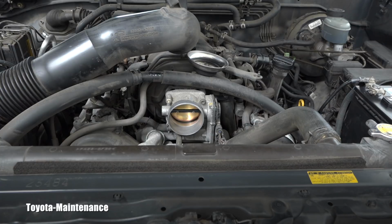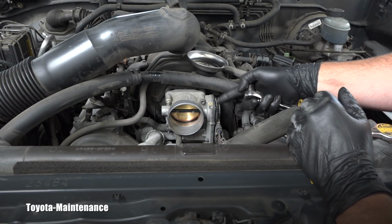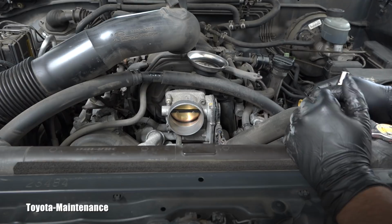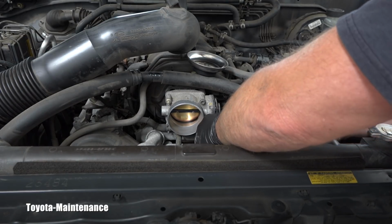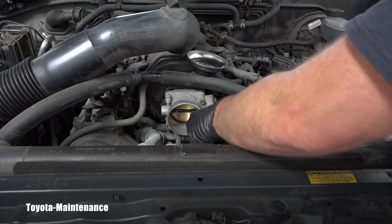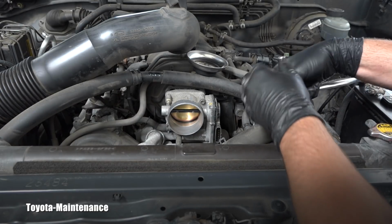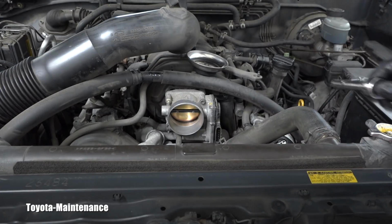Not fully, but yeah, there are motors here for moving this throttle body. This is not by cable anymore. This is all electronic. So I will squeeze the tab, right? Sometimes it's hard, but it should give. Oh yeah, clicked, right? Here is the connector. You see it? I will put it on the side. Now the throttle body can go. I will remove these bolts.